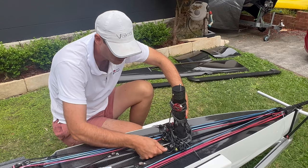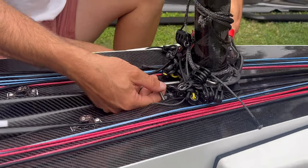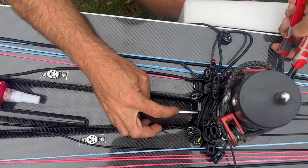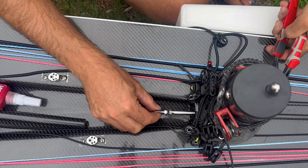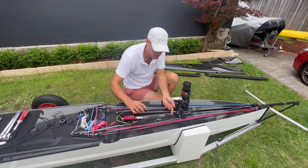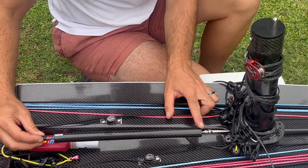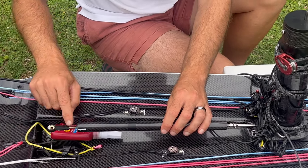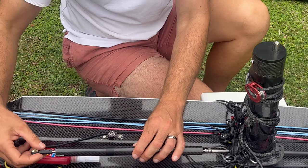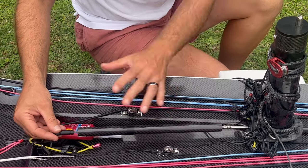Wind it in until it stops. Once near the end, check the alignment — at the moment it's not lined up, so back it off just enough to get vertical alignment of the stainless component. The adjuster can go up and down and rotate, so let it set in that position. As a good starting point: the shorter thread is 16mm, the longer is 24mm. Leave about 3–4mm of thread exposed on the short side and about 10–12mm on the long side, then find your settings within that range.